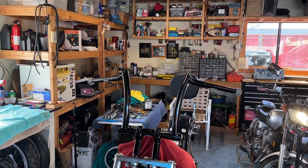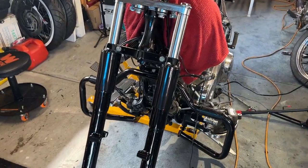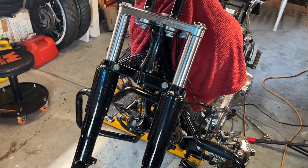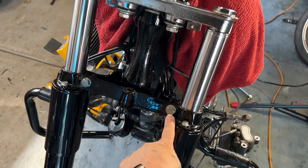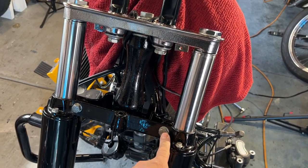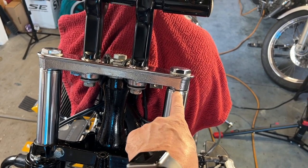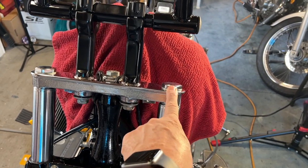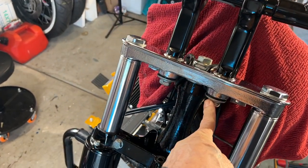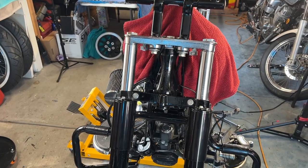I have not done the actual adjustment on the stem bolt yet, and the reason is I have to do the fall away on that. Basically the fall away is getting your handlebars completely balanced with the front wheel back on there, the fender, the caliper, and the rotor. I don't remember if we disconnect all the hand controls and all that — it's been a while since I've done one. We've got the new crash bar on there with all brand new bolts, everything is either stainless steel or grade eight. The plugs were torqued between 60 and 70 pounds — I torqued them at 65, right in between. The fork caps I torqued at 65 as well. These guys right here call for 35 to 40 — I torqued them right around 40. The forks are done.